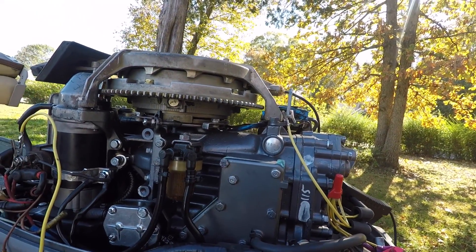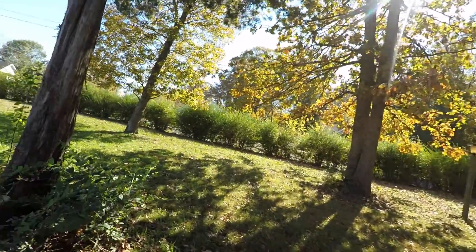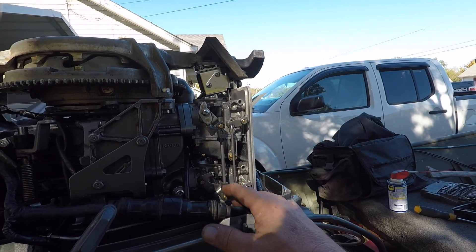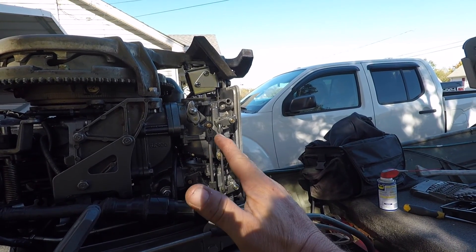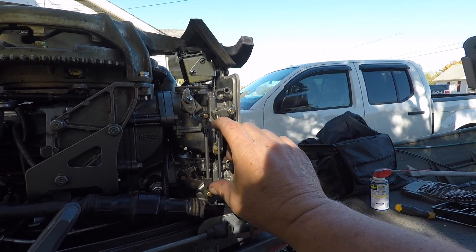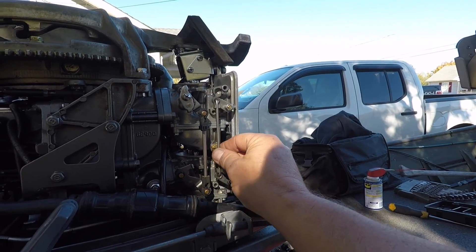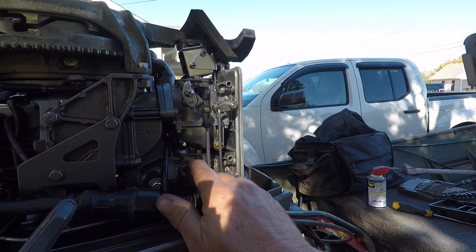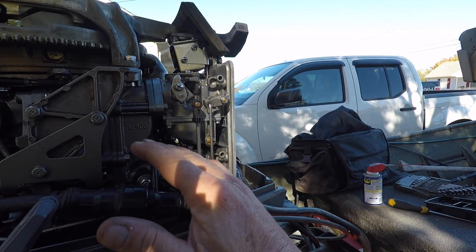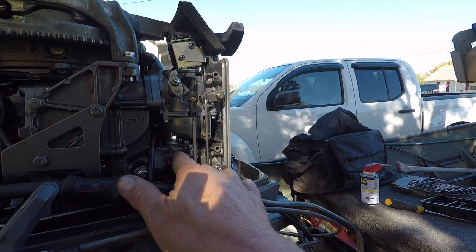When you're done, you're just going to have to go back and double-check your carburetors to make sure that at idle they're closed and at wide open throttle the butterflies are all the way open. And this is going to adjust the two venturis. That's your choke. You can adjust those up or down a little bit to open or close — but when we're at closed, tighten that down to the close mark.